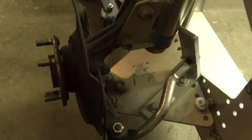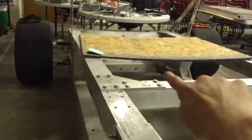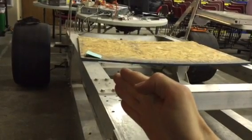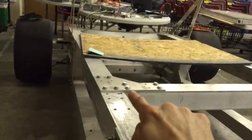That's how you'd adjust the toe. Please adjust the toe after you have it attached to your car, because most chassis have been welded. When they're welded, the metal moves towards heat. When these chassis are welded, they'll often toe — they'll tuck in on the rear — moving towards the heat of the weld joint.